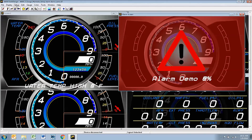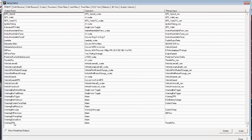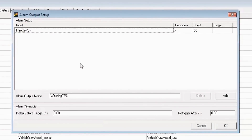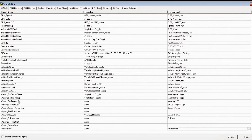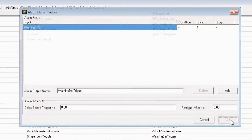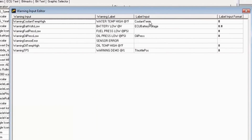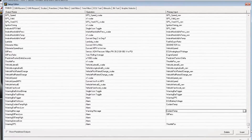I've gone through and set up a demonstration of how these are going to work. To do that, I went into Display. For the warnings, I've created a test warning called warning TPS — it's an alarm and its input is based on throttle position. This warning is going to be true anytime throttle position is greater than 50 percent. When this alarm is true, the bar trigger fires when warning TPS is one — because TPS is over 50 percent — and that'll trigger the alarm bar. The warning message will display what channel is currently causing the warning and also give its current value, referencing the throttle position current value.